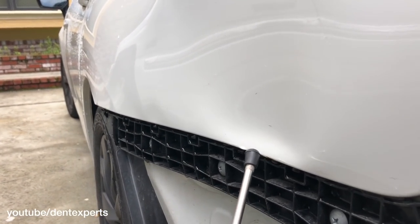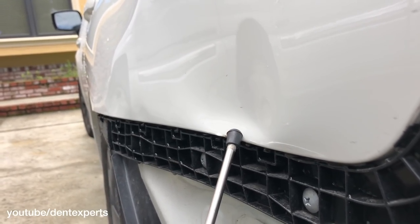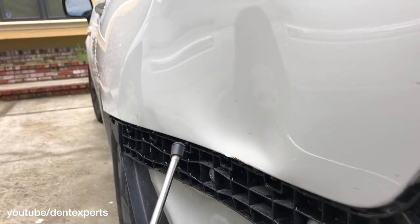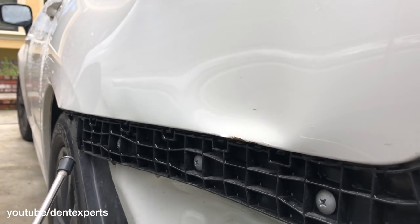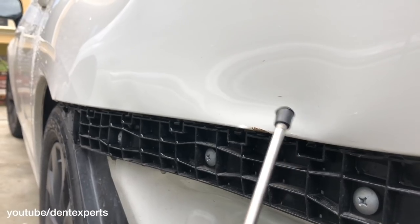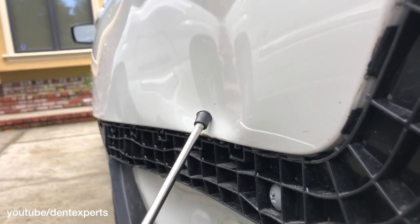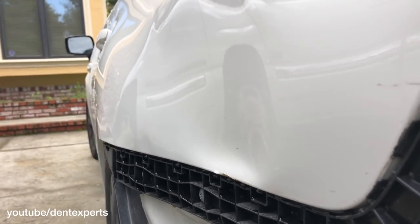What I'm gonna do first is push it with the hydraulic and then change the tip head to where I'm getting pushes right in the very corner and bringing that out. As a person that does this just about every day, that's what I recommend — pushing it. There's really no need to get involved with glue pulling, mainly because of the paint chip, but also because you really have to get good at pushing right at the very corner, the inside corner, and not just above it or half an inch above it, because you just create a lot more work for yourself.